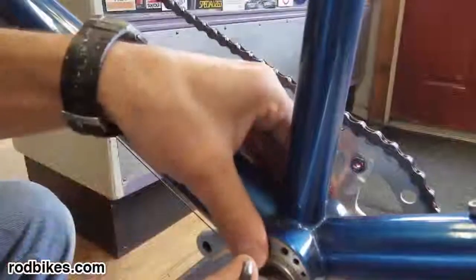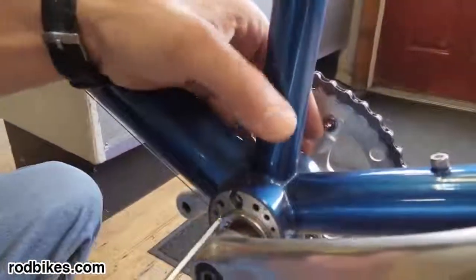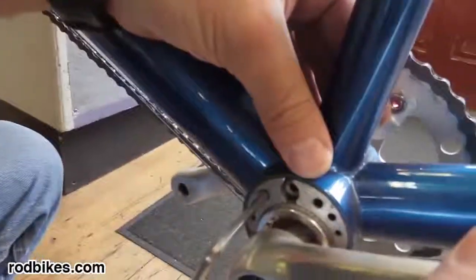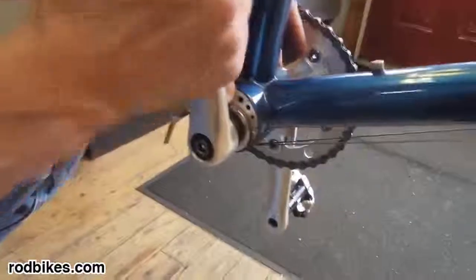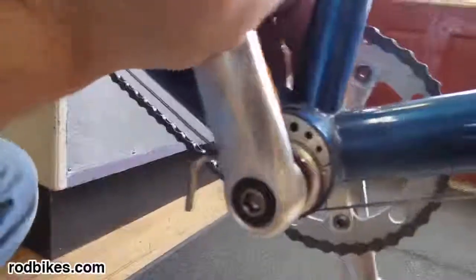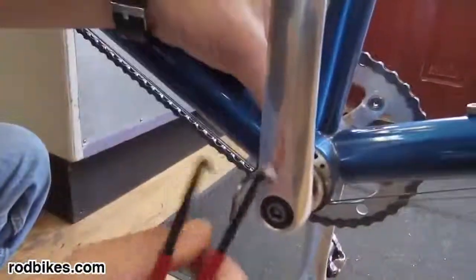So now it's loose again. Now if I want to tighten it and I don't have a spanner wrench, a lot of times it works just like this — you can put your wrench back in and back your crank arm around and just kind of pull like that. So in a pinch this works fine. I've got it roughly tight, but the ideal thing is to use the spanner wrench or something of that kind.